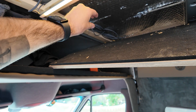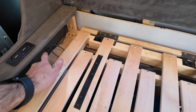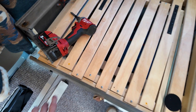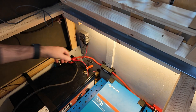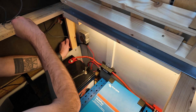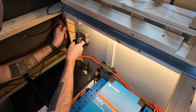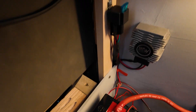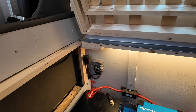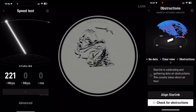After taking a few panels off, I've just left a bundle of the wires there. I'm going to properly secure them and leave the majority of them above the ceiling, but then the wires come down behind the wall, coming out from the bottom into the arm - I'm going to leave a little bit of slack. Now that all of the electrics are in and tied to the wire, and the switch on the side is accessible from the driver's seat, flicking it on turns on the switch, puts 48 volts up to the roof to the Starlink.